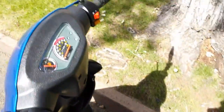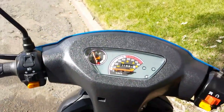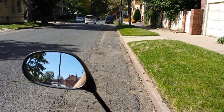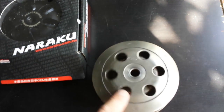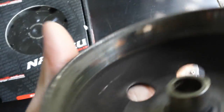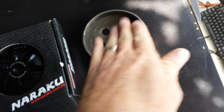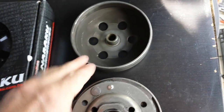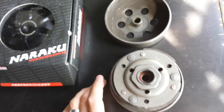The clutch bell is being glazed. I recommend replacing it with a slotted NCY or Naraku clutch bell that we sell on our website. This is the old clutch bell. If you notice it's got scoring marks, and that's from it getting so hot. So even though you can't see it, the clutch bell is warped. There are small waves in it causing it — every time the clutch engages, it's like shoes on a basketball court. You can hear the squealing from what we just heard on the scooter.